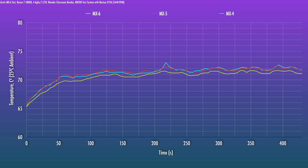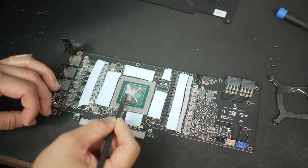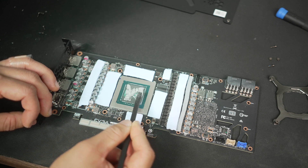As you can see, fantastic performance from the new paste — about 0.6 to 0.7 degrees better than either MX4 or MX5, and those two tested out pretty similarly. I'll note that I have seen MX5 oil separation before; my sample seemed okay this time, but consistency has likely changed — though it doesn't matter since it's end-of-life and just served as a reference point. I had actually tested the MX6 in conjunction with the new TP3 thermal pads, but had to pull that content from the last video since the embargo date changed. It worked well there, though the delta was smaller than with the CPU and air cooler testing.